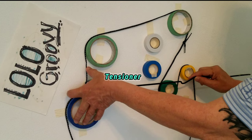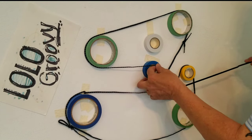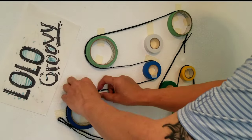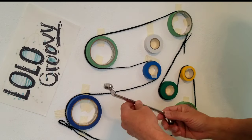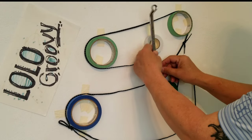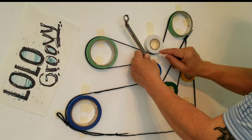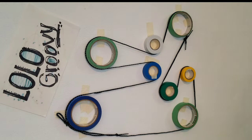With the improvised tool, grab the belt between the water pump and the crankshaft and pull it towards the tensioner, and set the belt in place. This is how it's going to look. With a 14mm wrench, turn the nut on the tensioner counterclockwise to loosen the tension. Then grab the belt and slide it to the idler pulley. This is how I do it — simple and easy.